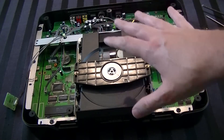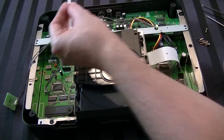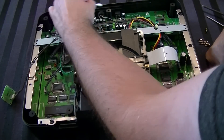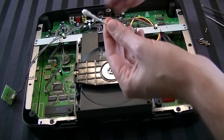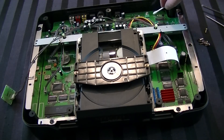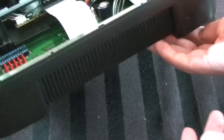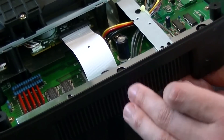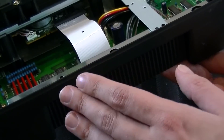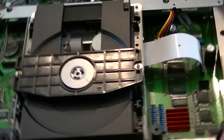The only other thing I can do while we still have this open is to use Q-tips to get more dust out of tighter places. Back here there's a nice big clump of dust coming off. Particularly around plastic areas, you might also take a completely dry end and rub along some of the board a little bit - probably optional, but it's nice to get dust out. One real winner was this crevice - the ring that goes all the way around the console. It was caked with dust. I took a Q-tip with some Windex and went right around that, getting a lot of dust out.